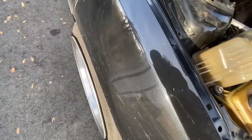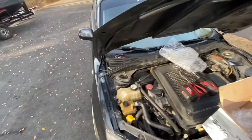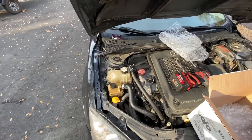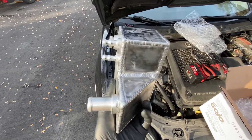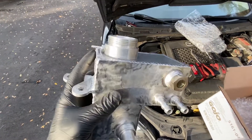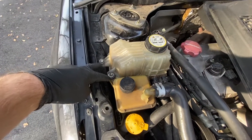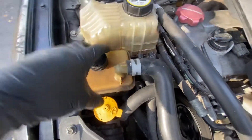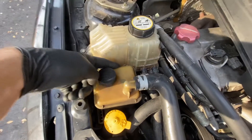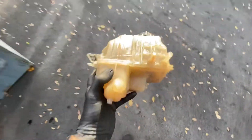Even when it comes to your paint — the whole fender is covered in residue from the coolant from when this one broke again before I epoxied it. Taking it out is super easy: just these two 10mm bolts right here, a hose clamp here, a hose clamp here, and once you get the power steering reservoir out of the way there's a third cooling hose on the bottom with a hose clamp. Take that off and this thing comes right out.